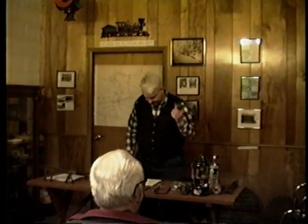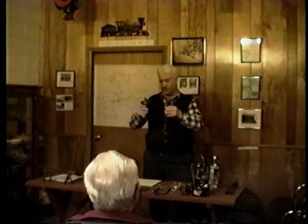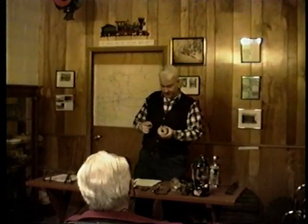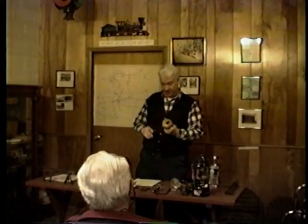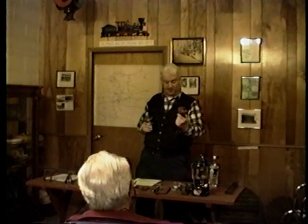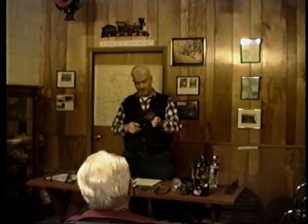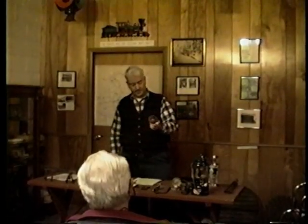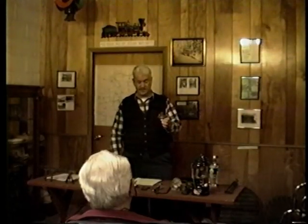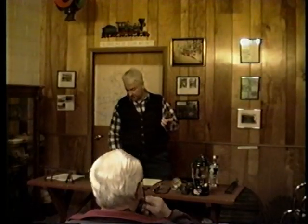Fuel automatic we talked a little about. It looks like the steam automatic, just a shorter version of it. Fuel passed through here on the way to the burner all the time, but when the steam automatic stopped the fuel from flowing and the fuel pressure built up, this would divert it back to the main tank. So this was a safety feature so that the fuel pressure didn't get too high when it got to the high setting, which was between 80 and 140 pounds depending upon what year.